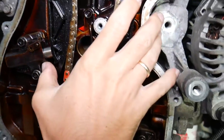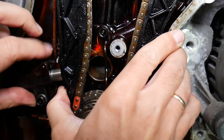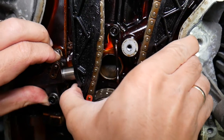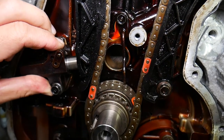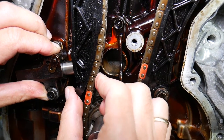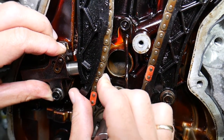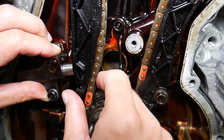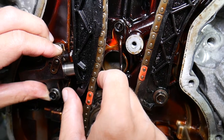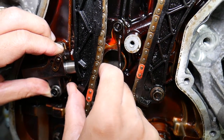I'm going to simulate the worn-out tooth. What will happen is that tooth will be so worn out that it will be skipping — the teeth will be worn out and when you park the car, oil pressure will decrease and your tensioner will retract. As a result, the chain will be loose, which causes the rattle. Practically, you can jump the chain and damage the engine to the point that you have to rebuild or replace it.